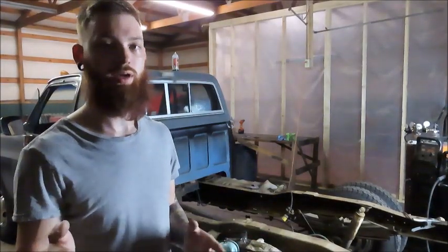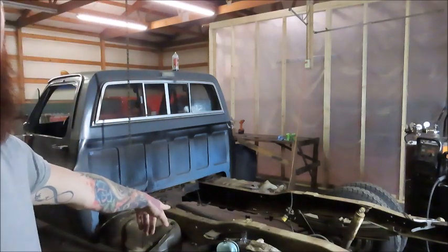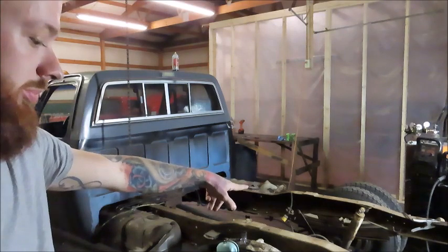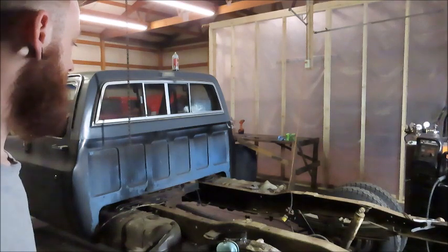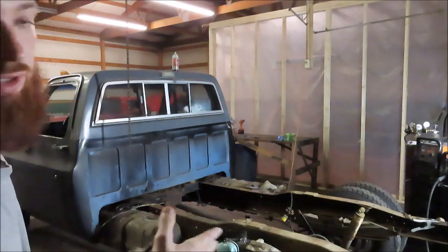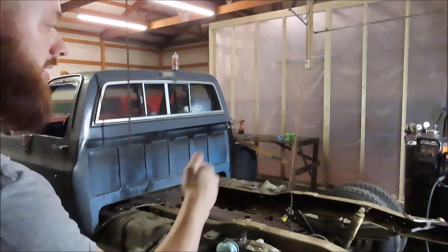All right, so it's a new day and I've got a couple hours to work on this truck. What I'm going to do next is go ahead and get this bracket off — this extra load leaf bracket stopper thing — then go over to that side, grind all those rivets out, get those leaf springs off. I do already have the sway bar off. Then go ahead and cut the mounts for the leaf springs off of the axle, check all the pinion angles and everything, then we can go ahead and weld the four-link on the outside bars and then figure out the inside bars as we go.